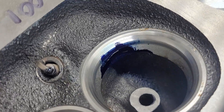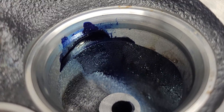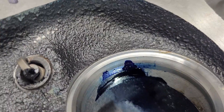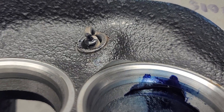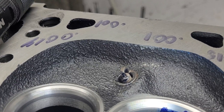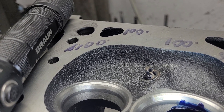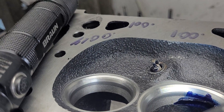Not terrible considering it's a stock bowl with deep cuts. Let's change that light, see if you can see better. You got a little bit on the roof, you got a little bit on that side. It's really not terrible — got some splash on the plug and just the faintest little bit of blue. I think I'm gonna wind up doing these chambers like I did to the Aussie EQs — knocking down this incredibly rough texture they have.